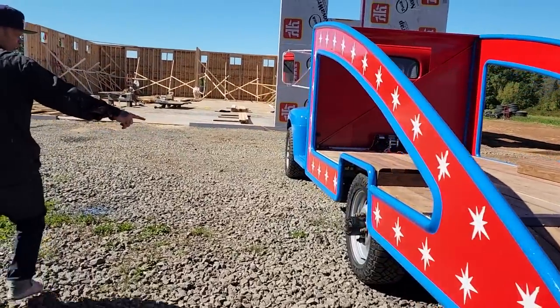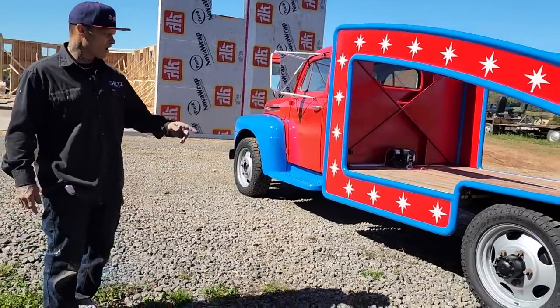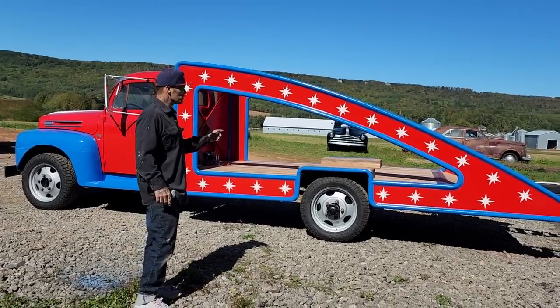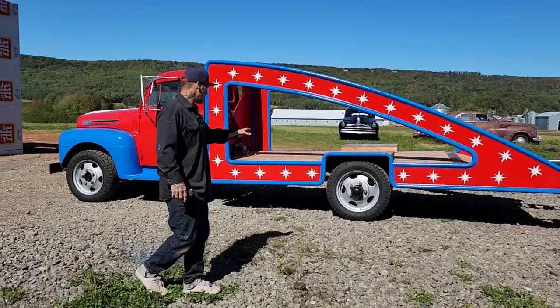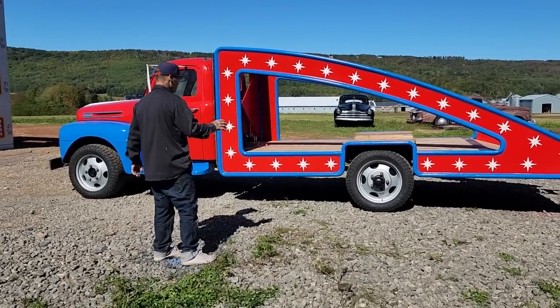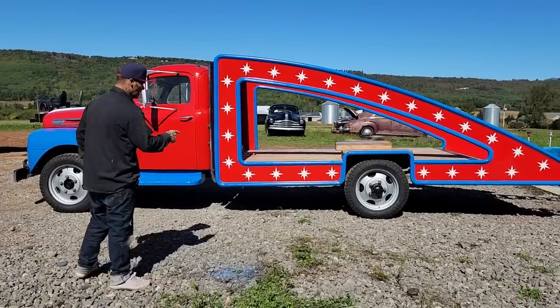I also took, not all the wheels, I took 4 of the wheels. It had 6 on it. Took the wheels off it and found some 20-inch Dodge wheels and made our own wheels. So we cut all the centers out of the big wheels that are sitting over there by the engine, and we made new wheels for the truck. That took a bit. We got a radial tire on it, so it's going to run good. We sandblasted them. I painted them. I blacked out the hubs.